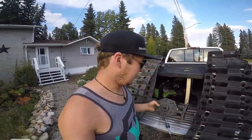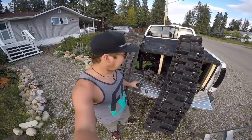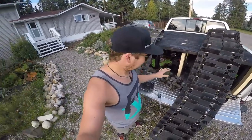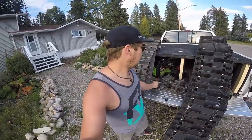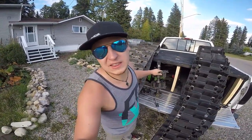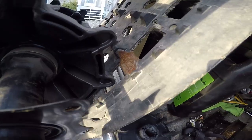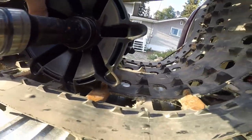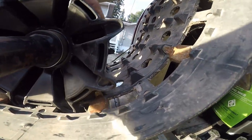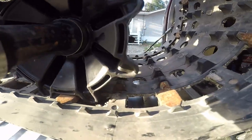I've got this set of drivers — an old set I had on the Phaser, a 2.52 set, and this three-pitch set — and I'm going to stick them in the driver lugs of the track so you can see exactly what's going on. Now, you may say these drivers look a little different from each other. I'll go over introvert and extrovert drivers in a different video. These are the old style, and these are the new advanced style. Three-pitch drivers work well in that three-pitch track — each lug is where it's supposed to be. You can see that these driver teeth line up exactly where they need to in the clip windows of the track.